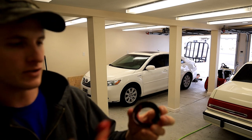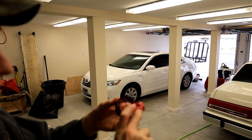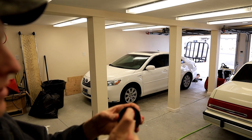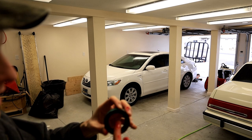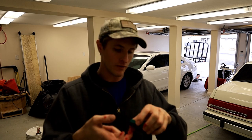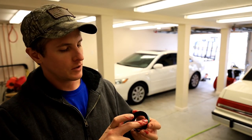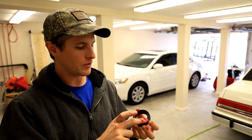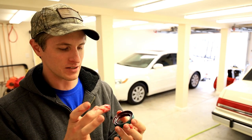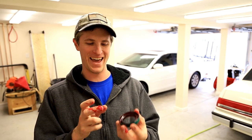But because I'm not going to use a seal driver, I'm just going to put this grease in here, and it's going to be a little shock absorber for it. It's going to serve no purpose other than to be a shock absorber. So I'm going to just wipe the excess from my finger into this, looks like a double lip seal, kind of a novel design there. But if it does pop out, you can usually get behind it with a pick or something and work that spring back up in where it's supposed to be. You don't have to pull the seal back out. I've never had it happen on these, but on some of the other types of seals, been there, done that. Trust me, it's just easier to put the grease in it. Let's head over to the hydraulic press and install the seal into the hub.